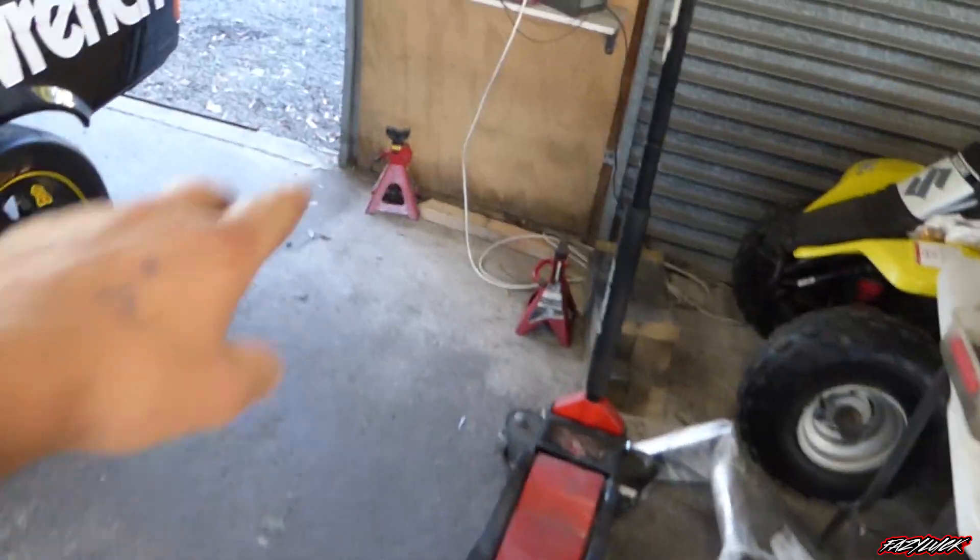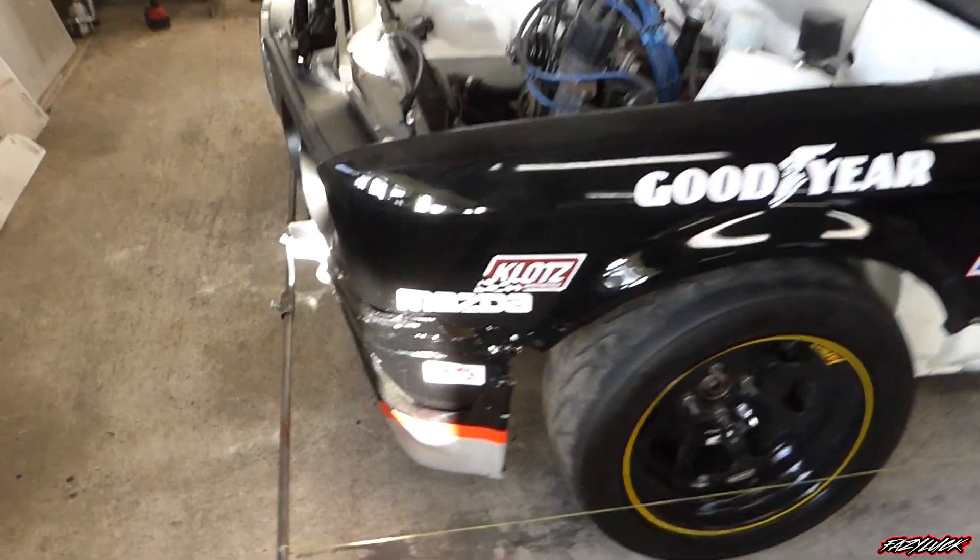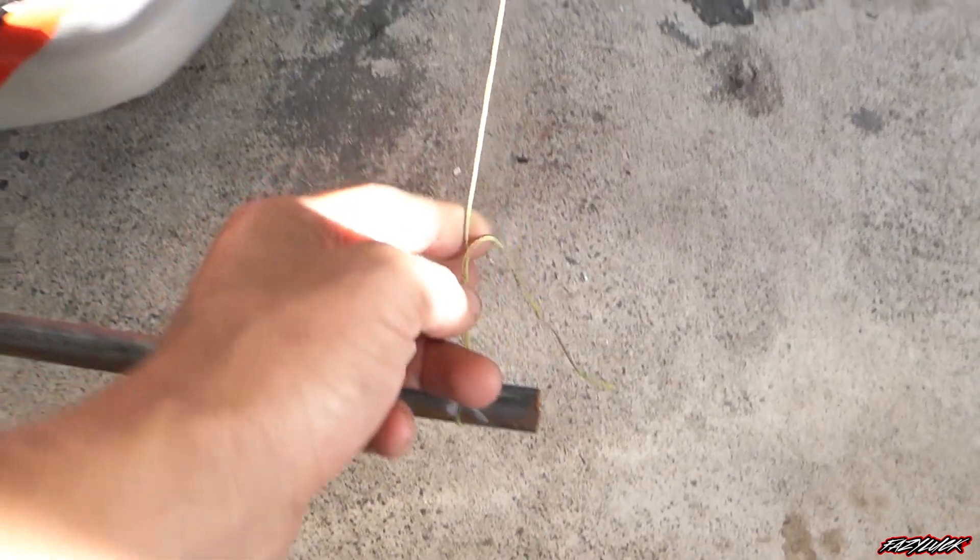Hey, Krista here, welcome back to the channel. We're back out in the shed working on the E30. I was up to the stage of wanting to get some sort of wheel alignment set up, since everything had been apart and was all out of whack. I started setting up some bars on jack stands but couldn't find two of them — turns out they're at a mate's place — so I decided to fabricate a bolt-on adjustable string line bracket set that bolts onto the bumper mounts.